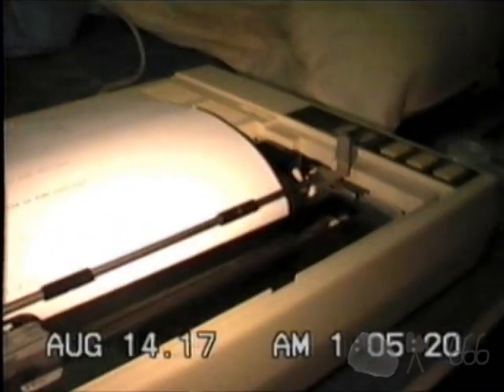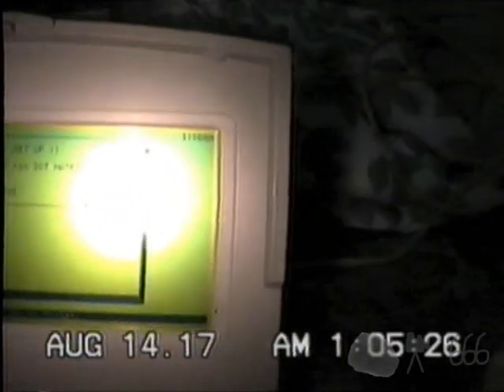So we're going to set up. We need to go into printer setup. You can see I've got this set up as an Epson 9-pin dot matrix printer. I suppose you could probably set it up for 24-pin, but it probably wouldn't even work. I have it set up for wide carriage, although I should probably just change that to narrow — I don't think this is a wide carriage printer. Near letter quality — you can set it to draft, but I'm going to set it to NLQ. And of course, parallel. If you were to hook it up serial, there's all your settings for that, but this doesn't have a serial port, so we're stuck with parallel, which is fine.